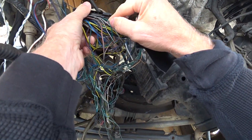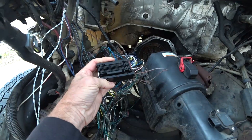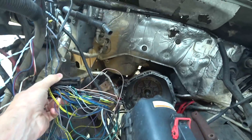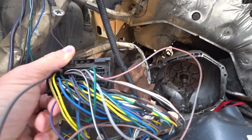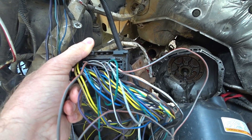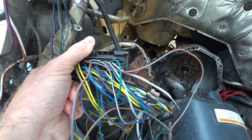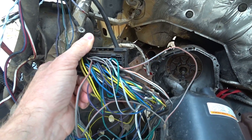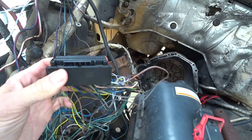I wanted to take the leads out — you saw me do this before — push the pins and pop them out. I probably should have left those in there and just snipped the wires and blocked them off. The reason is because the pins in the computer will be sticking through those little holes and kind of exposed to the weather where they could corrode. Having the leads in there and having the wire plugging the hole is probably a better solution. But the good thing is if I need it again, I can just put them right back in and it'll be just like factory again.